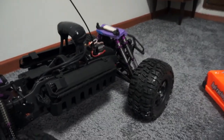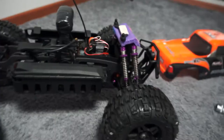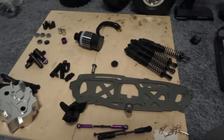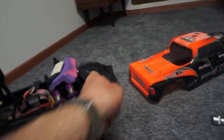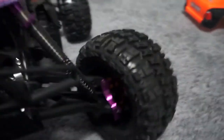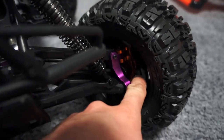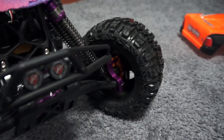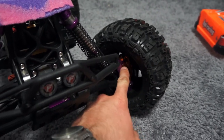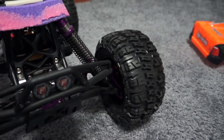And the steering seems to be okay, so that part over there, the steering point seems to be okay. So it looks like with Integy, some parts work well, some parts don't, and you never know what you get before you actually try it. I do also run these pieces here from Integy, aluminum, and that piece which goes to and holds the wheel axle. That's also from Integy. Those did fit well. I have some concerns about the bolts which hold them together, because I think they may unscrew with time, but I've put some Loctite in there. Hopefully it will hold. We shall see.